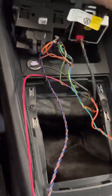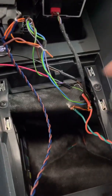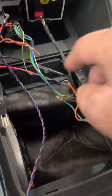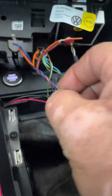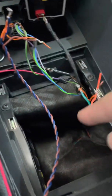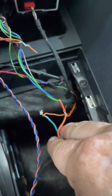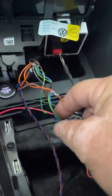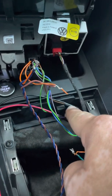When we open this module, these are the two CAN lines. We have to cut the CAN line. We have to maintain the switch, and after we cut the CAN, we connect the blue-brown to the module side, orange-green to the engine side or to the gear shifter side. Then we take the power, positive-negative, from the same connector on these lines — the red line and the black to the brown.